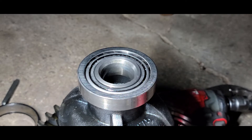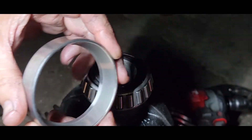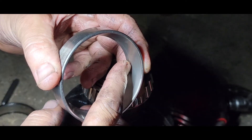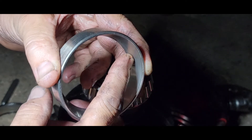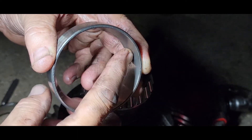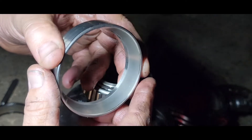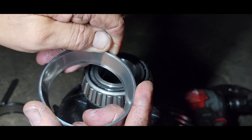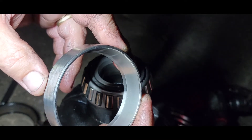We're just going to have a look here. Now this rear end only had one quart of oil in it, so we can see the wear on this. But when I put my finger across it, I can't even get any purchase on that edge with my fingernail. This is about 160,000 miles — this is the original rear end on this vehicle. That's not too bad. Now if the rear end had been properly serviced at 100,000 to 120,000 miles, it probably would look much, much better.